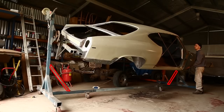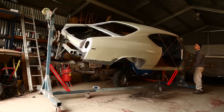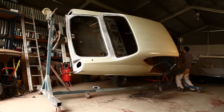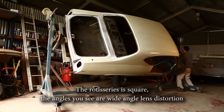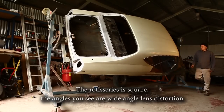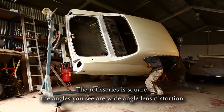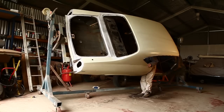This triangle section here is overkill. The first time I fitted up the rear rotisserie to the shell, I picked it up — the car wasn't completely stripped and there was some flex in the legs of the rotisserie, so it needed more steel, but this was completely overkill. What it does is reduce the range of lowering that the rotisserie can do, so I actually had to pick the car up quite high before I could fit it to the rotisserie.